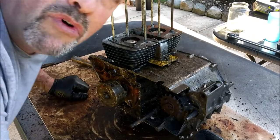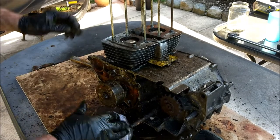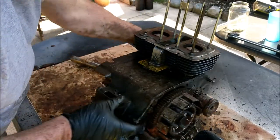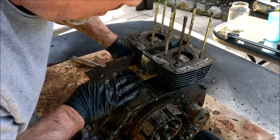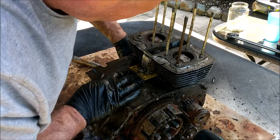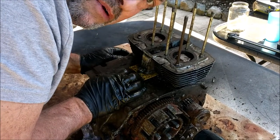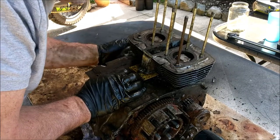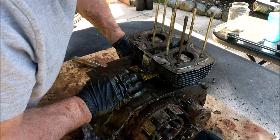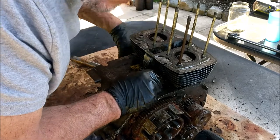Bear with. Right, after persistent banging, I have movement on my crankshaft. It's not a lot, but it is movement, and I can show you that. Look at this mechanism here. See that moving? Okay, I'll grant you, it's not moving a lot, but it's definitely moving. So I'm going to try my 14mm spanner breaker bar on this generator side again and see if I can get that turning over. If I can, it should pull or push these pistons up or down.